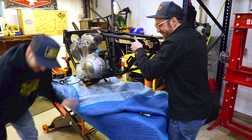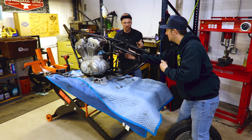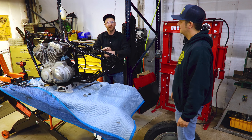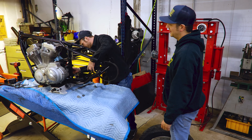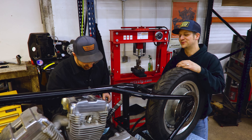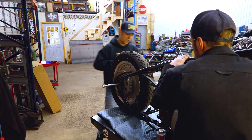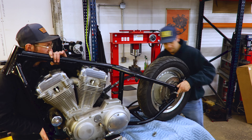Seth really doesn't want this sitting on his lift for the next two-ish weeks — this will be a roller, a hundred percent accurate. Rear wheel first. Your factory belt, being that we stretched the old hardtail kit — too short, guys. Two inches longer on the hardtail kit. Chain conversion kit option one, or if you're lazy like us, extended belt. Brought to you in part by ThrottleAddiction.com.